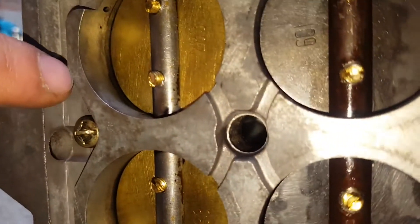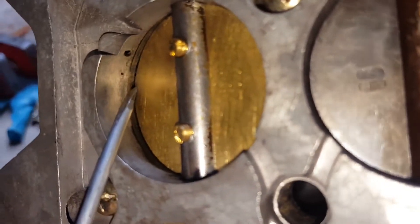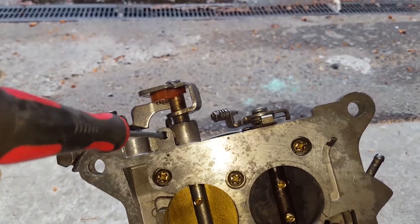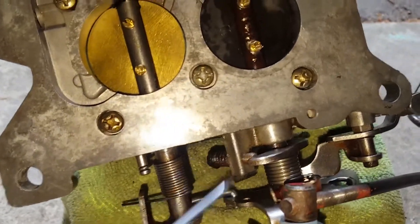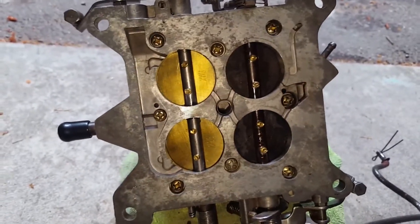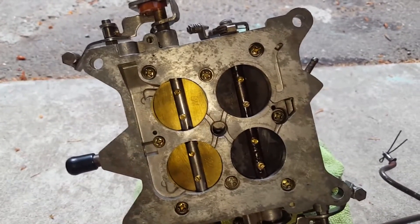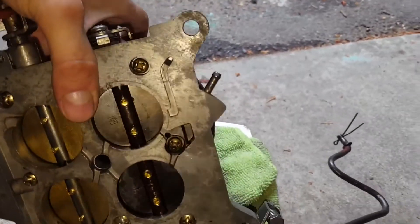On this side I've done pretty much the same thing. With mechanical secondaries, these don't need to be open, but I've got the transfer slot on that side just slightly exposed. You can adjust that one by turning the little flathead screw in here, which lets you adjust the secondary plates. The idle screw on this side does the primaries. Initially I may need to tweak that slightly, but going forward I'll try to adjust the idle using the secondary plate — open it if I need a little more air, close it slightly if I need less.